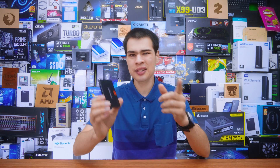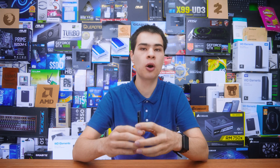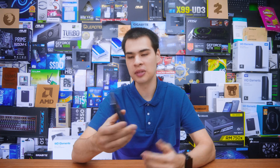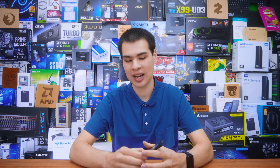Before we jump into some performance numbers, let's roll back the clock and see what makes this guy tick. Back in 2012, this guy was based on the 21 nanometer toggle TLC NAND flash in sizes from 64 gigabytes — this is from a time when 64 gigs and smaller were still a thing — all the way up to 512 gigs of capacity on the 840 Pro. It's also using Samsung's MDX controller with 3 years warranty on the standard edition and 5 years on the Pro. We're also seeing 512 megabytes of LPDDR2 cache, which is definitely a far cry from today with most SSDs coming out with well over 2 gigabytes of LPDDR4 RAM for caching tasks.